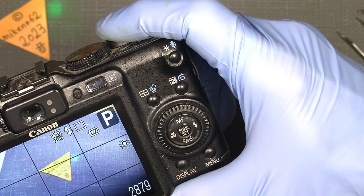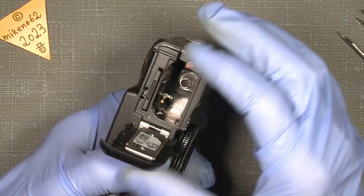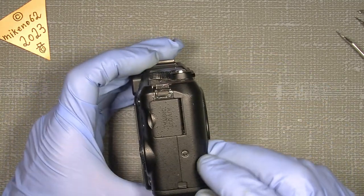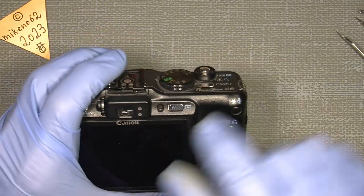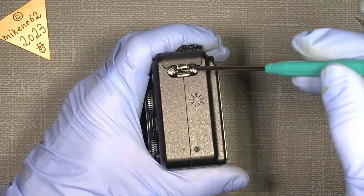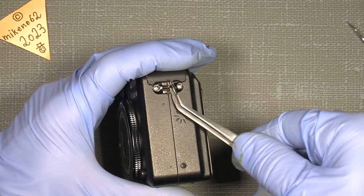The camera is working, so now we know that, which is fine. Take out the battery — no need to take out the memory card. To get into the camera, you take out two screws here, the two bottom screws, one screw here, there's a screw underneath the lid, one there, and one more. We also get those two for the strap holder — it shouldn't be a big problem to take off.